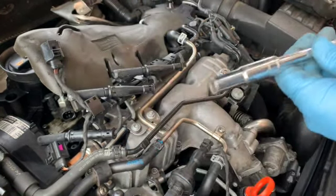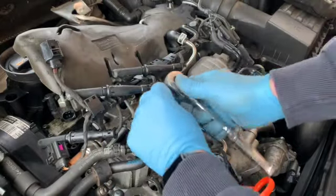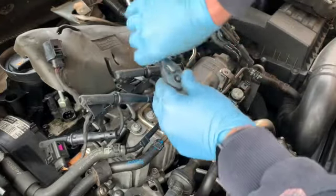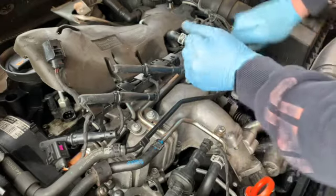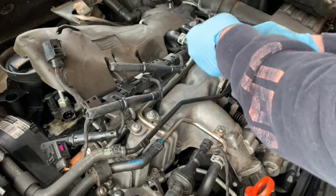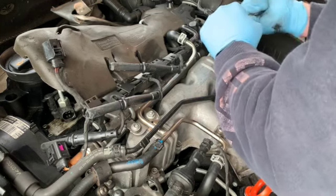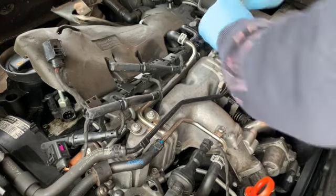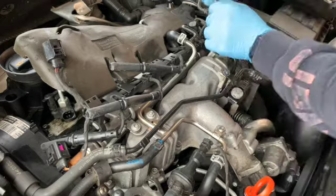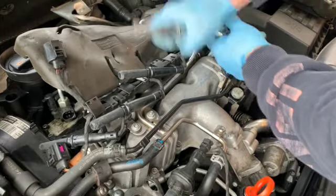Just use a 10mm extra deep socket. I wouldn't use any sort of power tools on these, especially when undoing them and especially when doing them up, due to the fact that it's all aluminium. That one's tighter - you don't want to make a mess with impact tools. I might have to be a little bit ginger with it so that it doesn't shear, so just backing it off, tightening it up again, and then hopefully it'll come undone. This is a 2010 car, it's 2020 now, so these have been in 10 years. I've had the car probably six years and I'm pretty sure they've never been done.